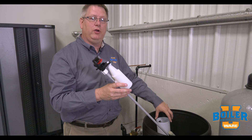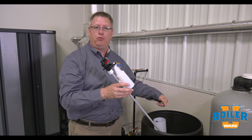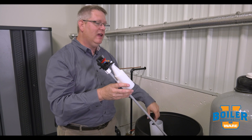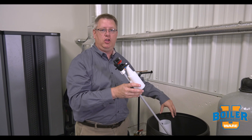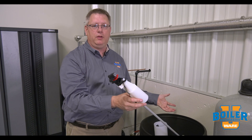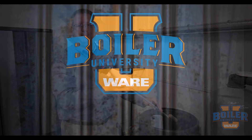Secondly, we can actually take a hose and put it inside the foot valve tube and just allow it to run for a while, maybe while dissolving some salt to clean out the brine tank. And that'll just dissolve any salt that's migrated into or accumulated in this tube. And that's just going to make sure that everything on this end of the softener is working properly, so that the rest of the softener can do its job.